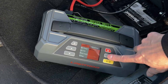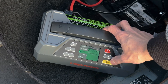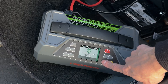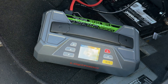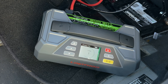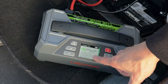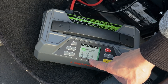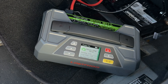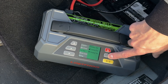Now go to battery test, then charging test. During the test, engage all loads and increase RPM to 2,500 to 3,000 RPM. We have a result: generator voltage normal, initial voltage 10.3, average voltage 13.69, upper voltage limit 14.82 volts. So we know the alternator is good in this car, which is great.